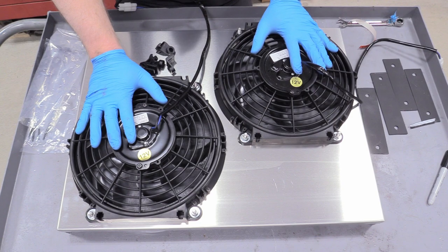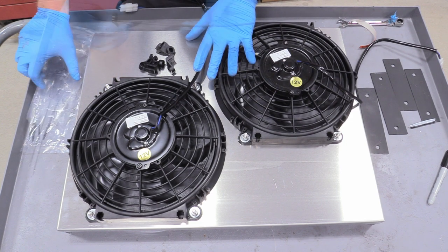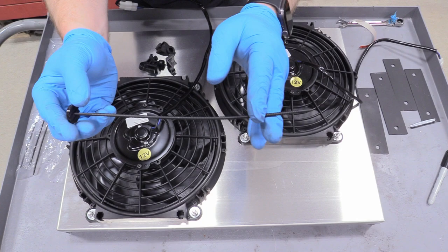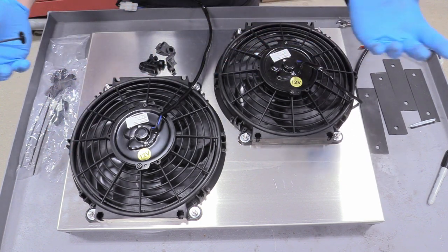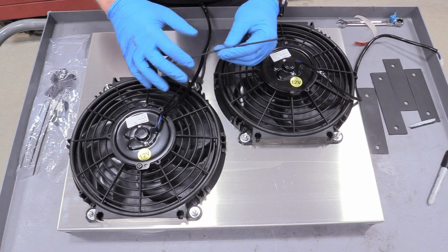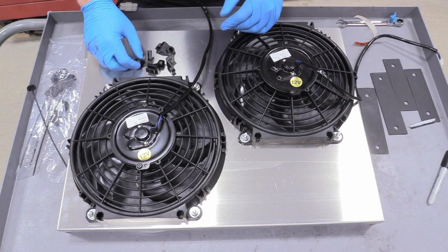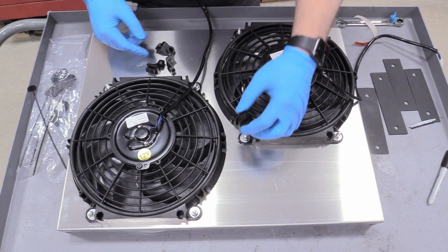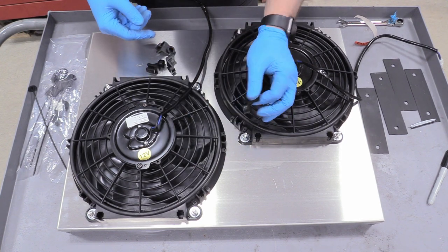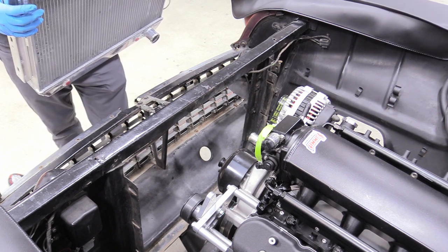These fans are universal, so if you have a weird radiator or no bespoke shroud, they do come with these zip-tie style mounts that go through the fan and through the radiator with a little securing clip on the end — that way your fan doesn't go anywhere. On my '67 Camaro there really isn't a way to mount fans nicely; it's just kind of attached to the radiator. They also come with these offset adapters that give you different options on where to put bolt holes on the shroud, so there's a lot of flexibility. The link is down below in the description.